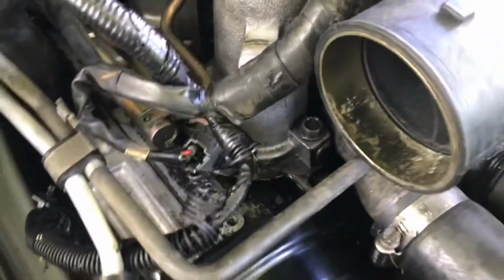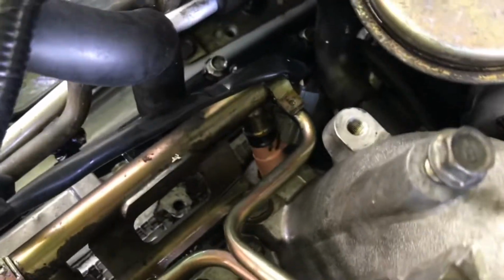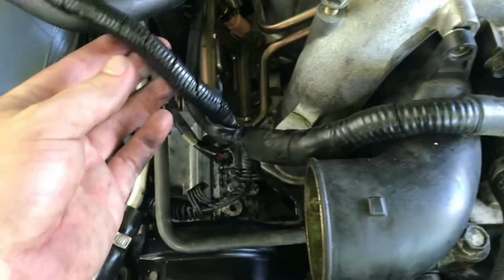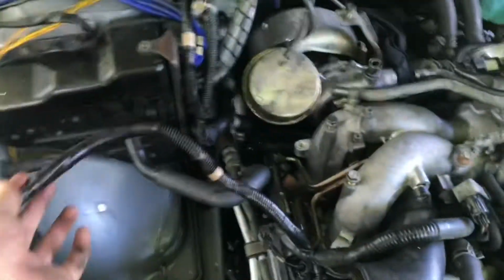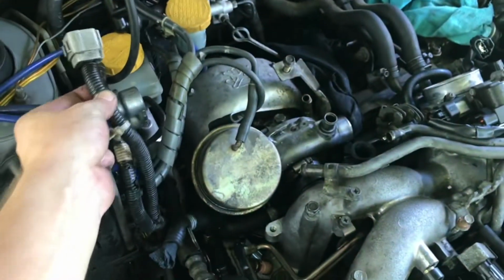Just to sort of see what we're looking at, I've degreased the block down. The injectors, the fuel injectors, are actually attached to the rail. So that means I've only just got to lift it up and move this loom out of the way. This loom here, in a nutshell, basically it just goes underneath here, does the 2 injectors, does the 2 leads, and then comes up and plugs into this one, which was mounted on the vacuum solenoid box.